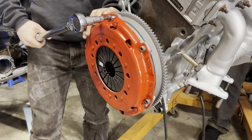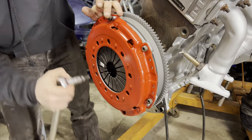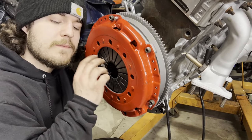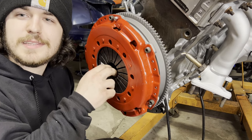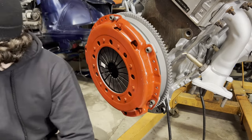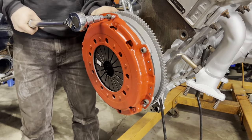That doesn't seem right to me. Online, where's the book? Did I really get these at spec by hand? There's no way. Or maybe it's just my torque wrench. Yeah, good old Pittsburgh torque wrench. For 8.8, it's 16 to 17 foot-pounds, and then for the 10.9 bolts it says 25 foot-pounds. Fuck it, we'll split the difference. We'll go 20. 21.